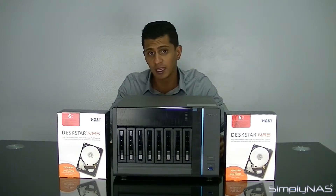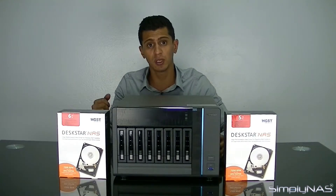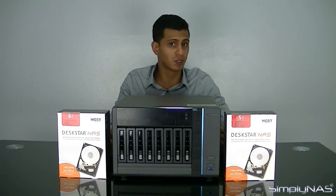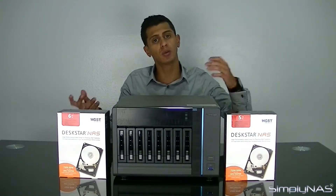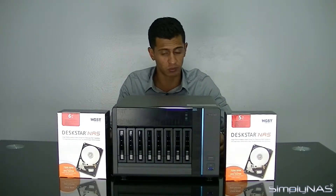Once you've plugged in a hard drive and set up the backup for it, the NAS will remember that hard drive is supposed to be backed up, so next time you bring it in it'll copy directly into the share folder you've designated. When you do the first ever one-touch copy, the NAS will ask you where you want the data. We generally say dump it all in one share and then organize it afterwards into the directory structure you wish.